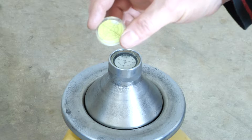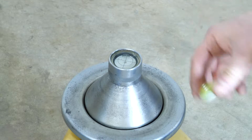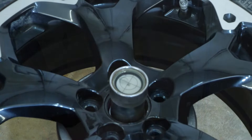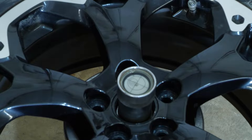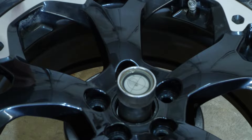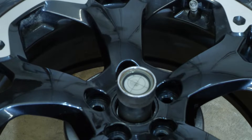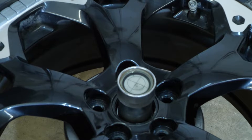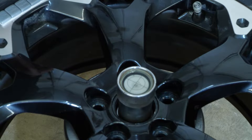Your only option is to buy one of those stick-on bubble levels, which are easily available in approximately this diameter, and glue it on top. Here's a wheel on the Coats bubble balancer — it's a little bit out of balance. This is actually a dynamically balanced wheel from a Subaru dealer, but it shows out of balance here. This is the side that needs weight — it dropped, showing it needs a lot of weight. Now it's almost in the center, needs to be a little bit this way.